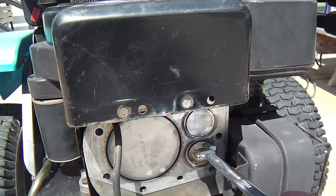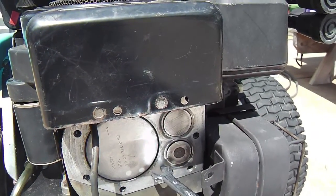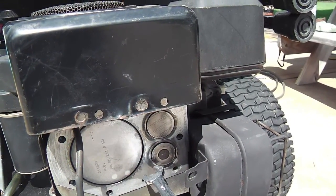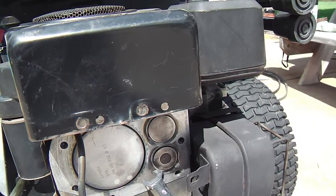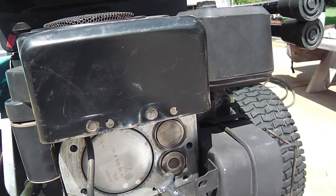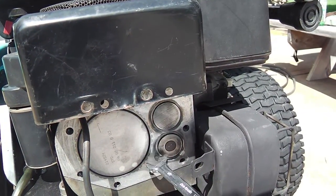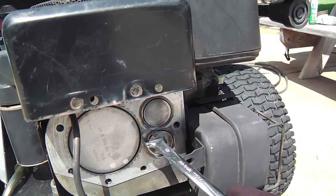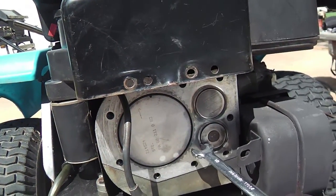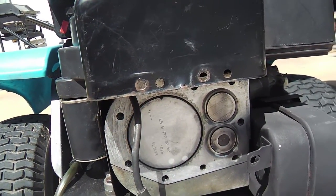Here's the valve seat down on what they call the valve seats. But beyond that, this area right here is called the eyebrow. And that eyebrow normally has a very sharp edge. You know, it's angular. Apparently a common slight modification you can do to get better intake and exhaust evacuation of the gases is to slightly grind and sand. And that's what I did. I took a Dremel and an orbital sander, and I softened that edge, widened it, and just made it so it would flow better in and out. So that's one other slight modification that's hopefully going to make this all come together and give me the power I'm looking for.